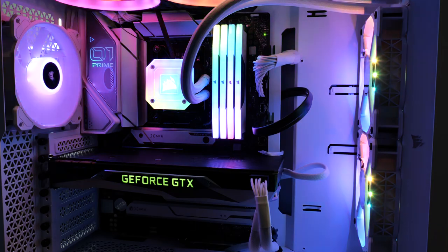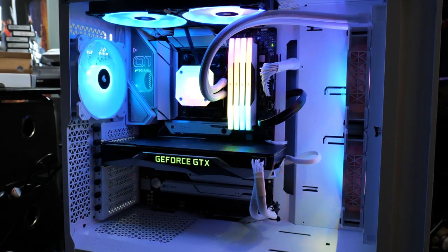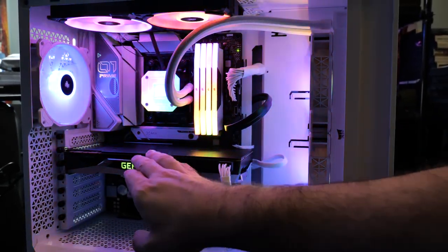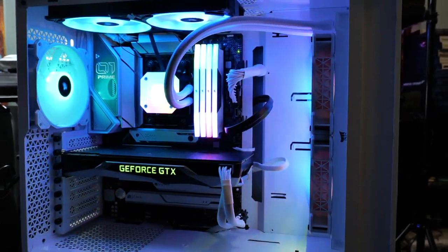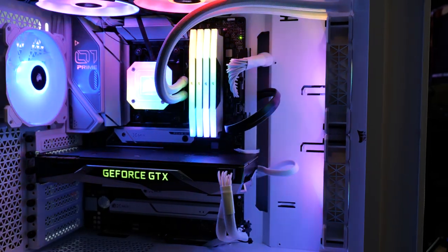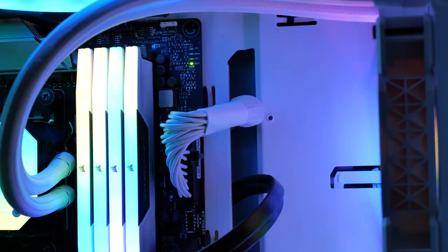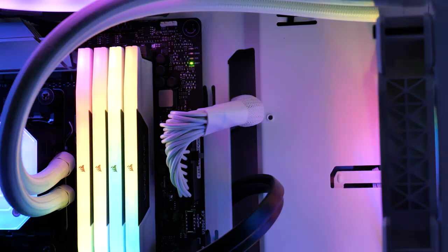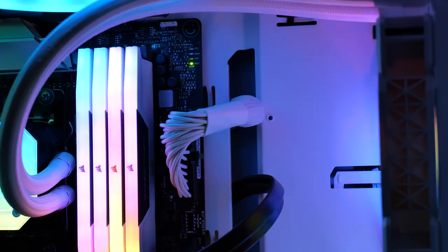All right. So we powered it on, it does power on, it does work. This is what the inside of it looks like. We are using an older video card that's like 6-7 years old for the time being. Now initially, this is something you guys want to pay attention to. No matter if you're an experienced builder or not, things can go wrong. And these little lights up here in the corner, one of them is for the CPU, the RAM, the video card, and the boot. So, one of those up there lit up for the RAM. And it gave me a RAM indicator.